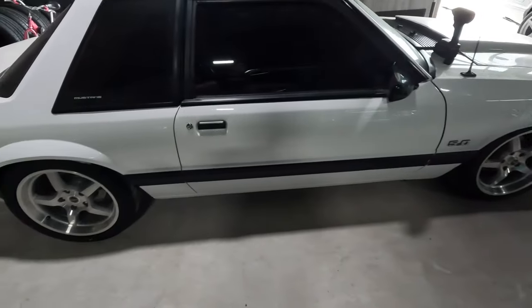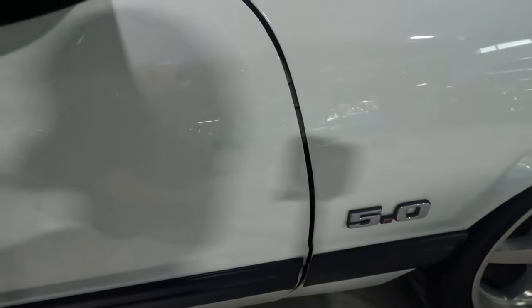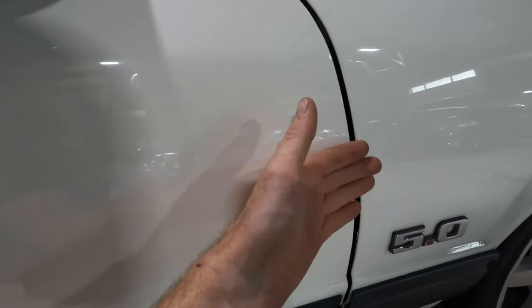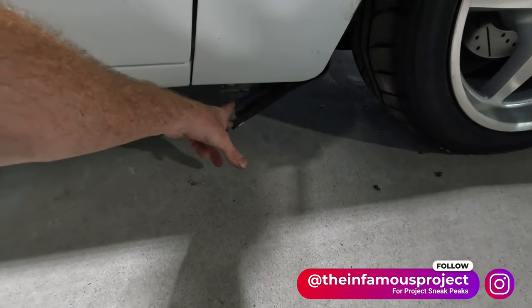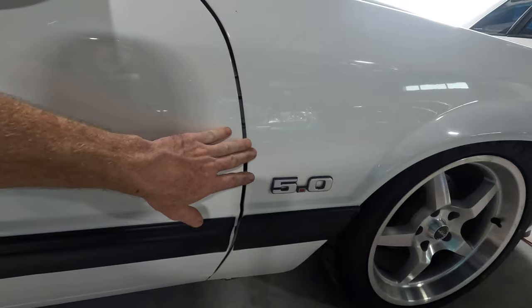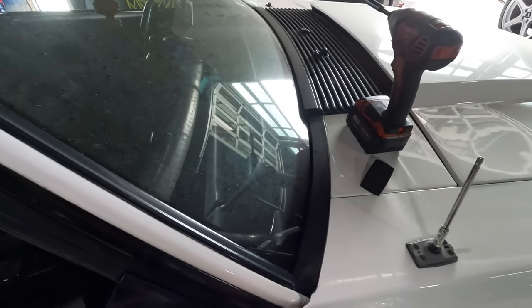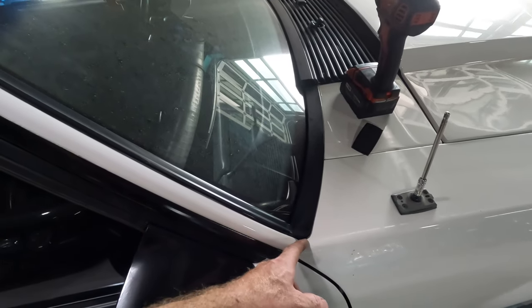When we look at this door, we have a really good line right here — the door opens and closes fine, there's no issues, it's nice and tight and solid — but then we have this door gap here. There are a number of different types of gaps. Sometimes the fender gets pushed out from people jacking up on the pinch welds on the underside. When we look down here everything's nice and straight — we don't have the classic 'I jacked my car up on the pinch welds' issue where the fender flexes and bows out. It actually needs to go in just a little bit, and we need to get it back just a touch. You can see this fender can go back towards the pillar a little bit — even a couple sixteenths of an inch is going to make all the difference.